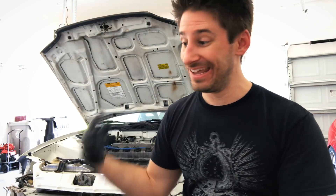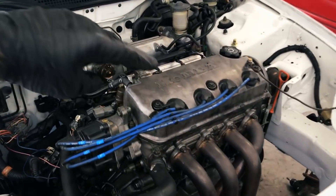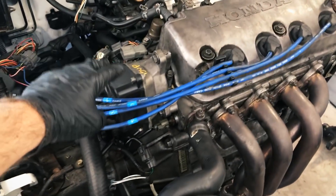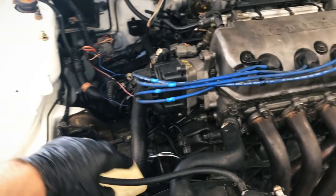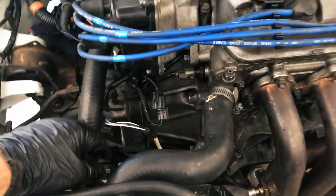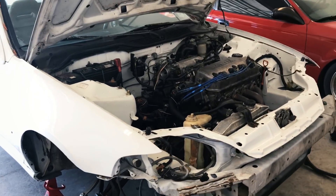This is like super easy work, but it's kind of nice — I like doing little jobs like this. I've been busting my butt doing all this suspension stuff over the past couple of weeks, so this is a nice light job. In case any of you were wondering: this is a D16Y8, everything is OBD1, this is a D15B7 distributor, and it's a P28 stock ECU inside the car. The wiring harness is actually from a 95 DX — we took it off there because it's got the four-wire O2. This car is originally a CX, so it only had the one-wire O2.